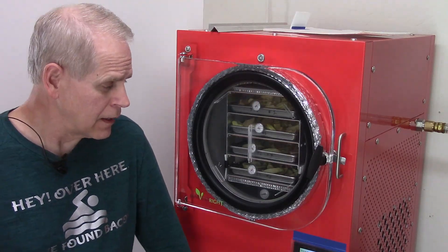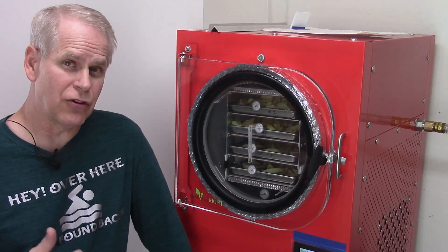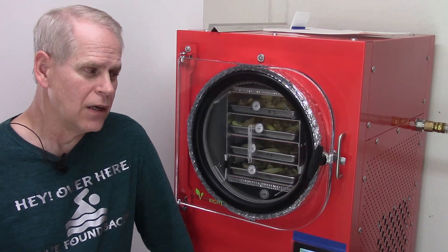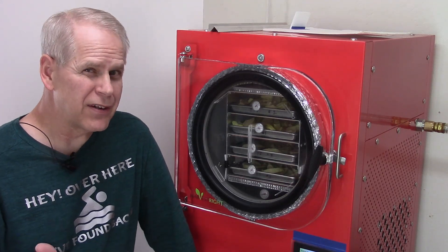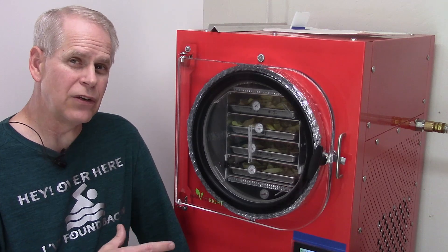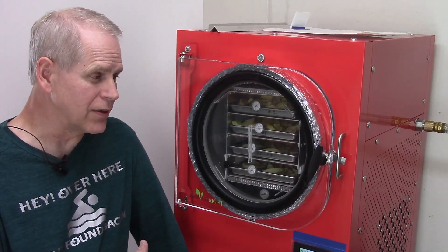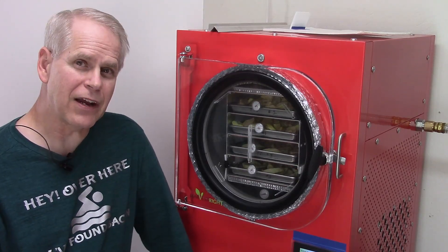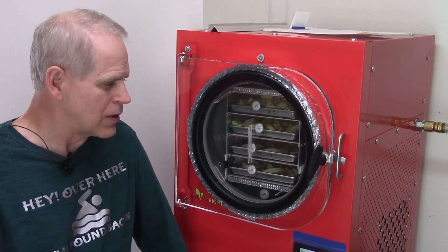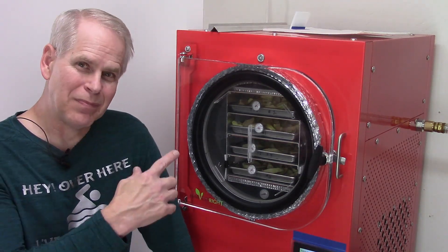I've given it just four more hours of dry time. Since it's going to be overnight, you could give it any amount you want — you could have it run continuously until tomorrow. It will use more electricity because the heaters will be cycling on and off to keep the trays at 120 degrees, and because the vacuum pump will be running. Without the vacuum pump and heaters it's about 320–330 watts; with the heaters, vacuum pump, and cooling unit it's up to about 1,350 watts — considerably more power. If you don't care about power usage you could just let it run, but it's also more wear and tear on those components.